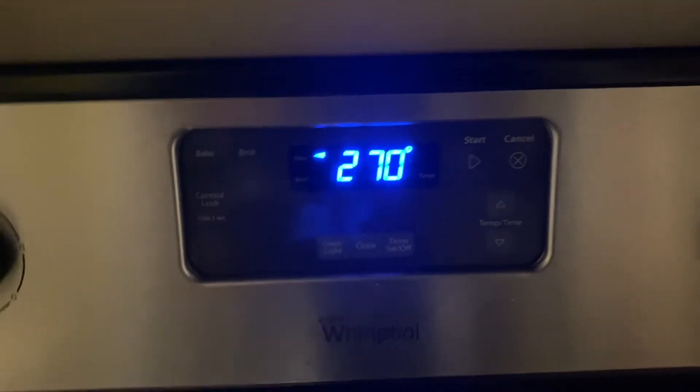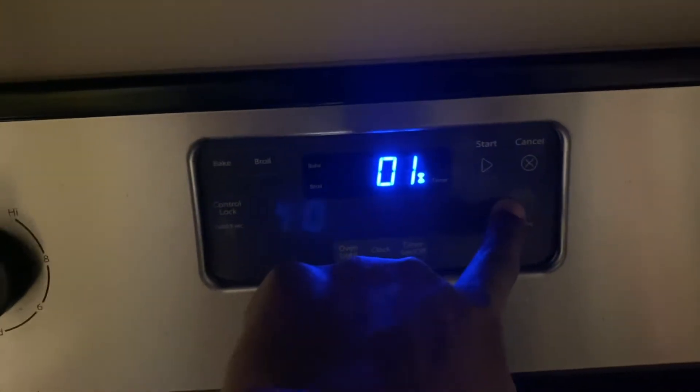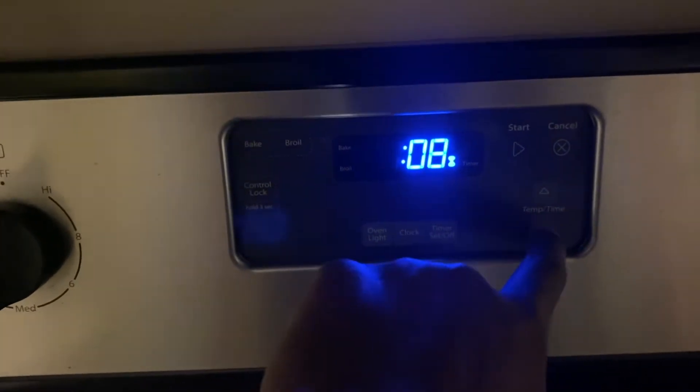The headlights are out and now we're going to put them in the oven. You usually put them in the oven anywhere from 200 degrees — just don't go over 270 degrees. My sweet spot is about 250 to 270 degrees Fahrenheit, and I put them in for about five to eight minutes.